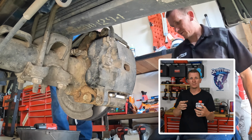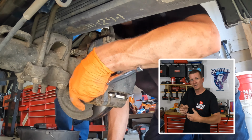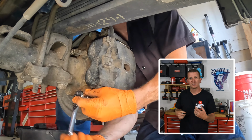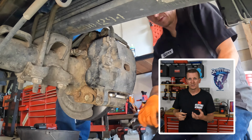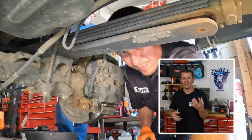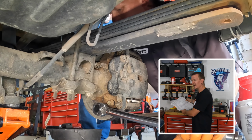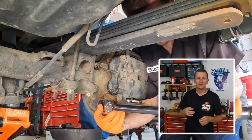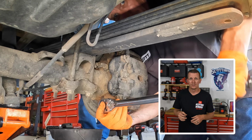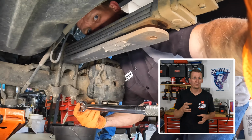If you have a little bit of problems putting the brake pads over that rotor, you might want to slide them out a little bit, just pull them open to slide it over the rotor. I'll just start that top bolt a little bit, and I'll go down to the bottom and tighten the bottom one up first. The proper torque specification on the caliper bracket to hub assembly, or to axle, is going to be, let's see, 148 foot-pounds. So 148 foot-pounds of torque going on the caliper to bracket bolts. Nope, 148 foot-pounds are on the bracket bolts to the actual vehicle.